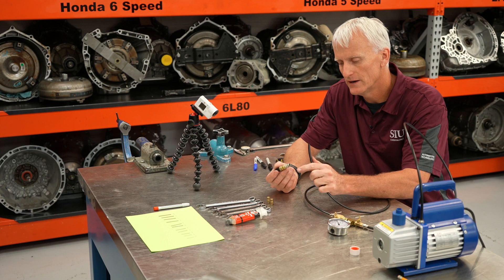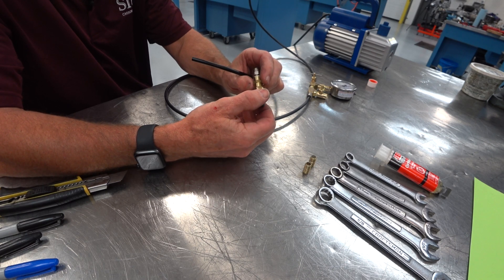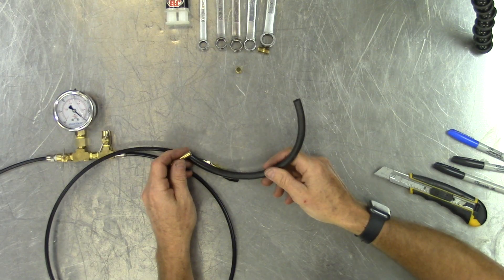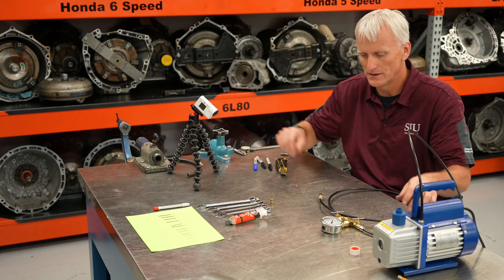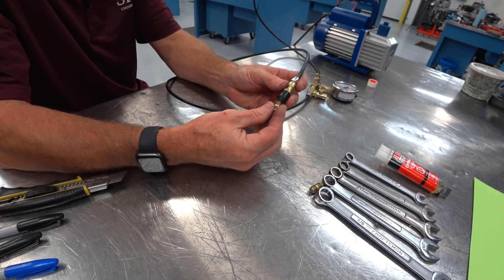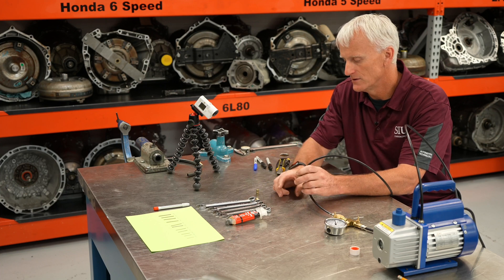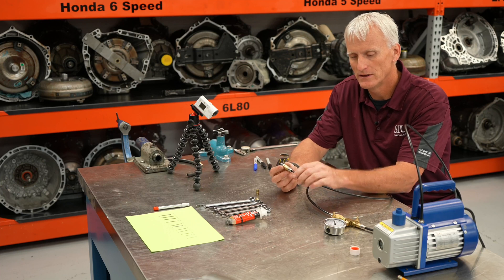At the end of this hose, you could do a variety of things. I went ahead and took an air gun tip and put a coupler on there with another push fitting, so I can just slide that on there. You could take a piece of vacuum hose and slide it over the fitting with a barb. I chose this method because I can easily pump through my calibrated orifice just by sticking the nozzle into it, and then when I go to test transmissions I can just go straight into the test plate.